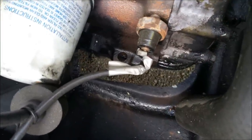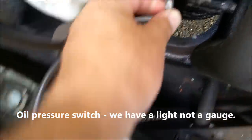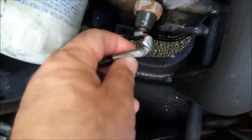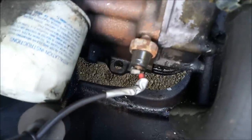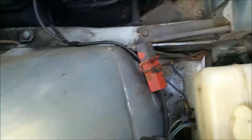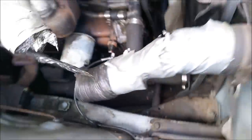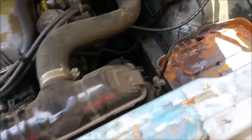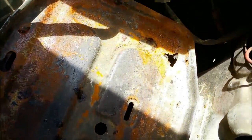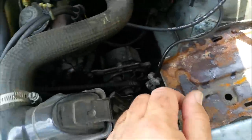You can see the oil pressure sender isn't registering on the dash - I don't know why, but that's knackered. We need to look at that. The cable tie is wrong. It's just dirty and worn out. We've got a good radiator though - it's been replaced. Here's our battery clamp which has come off and has some rust, which we can fix. There's a relay here that wasn't there when the car was new - maybe it's a starter relay.